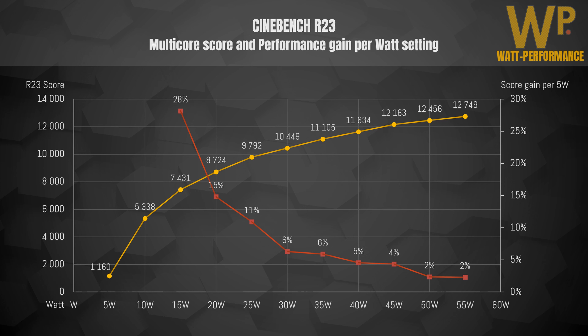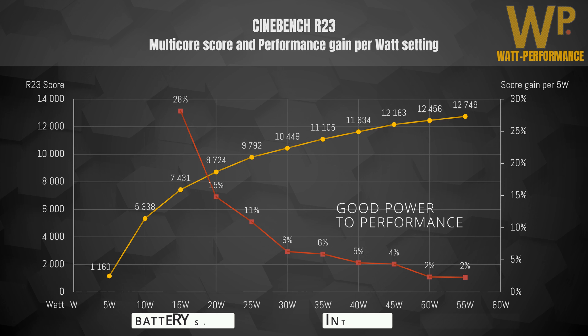To round off: the AMD Ryzen 6800HS performance is fantastic, especially at lower TDPs, with the overall AMD trade-off of not being able to leverage high power envelopes as well as Intel. However, exceeding 45 to 55 watts usually means bigger, bulkier laptops, and this is why I believe AMD to be the king for slim PC laptops with good battery life. The listed TDP of 35 watts seems like a perfect cutoff point to optimize performance whilst enabling slim laptops. For the Yoga Slim 7 Pro X, power alternatives range between 15 watts all the way up to 55 watts of sustained power — I mainly stay in Intelligent Cooling mode for excellent performance and manageable fan speeds.